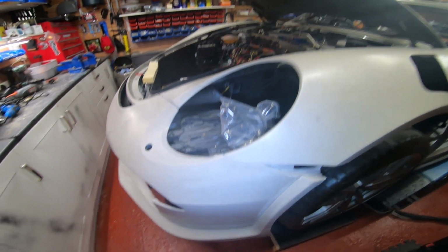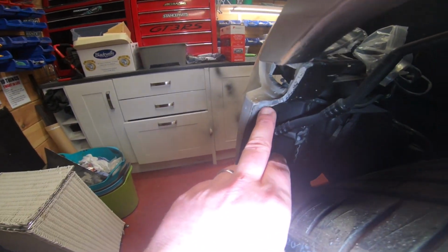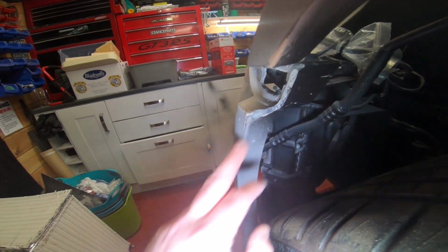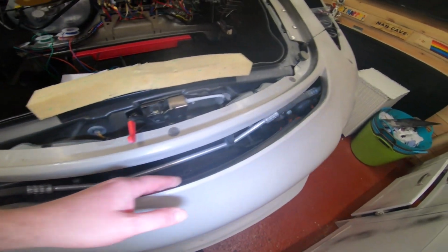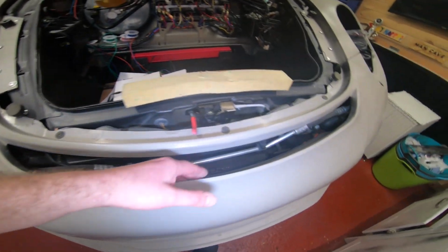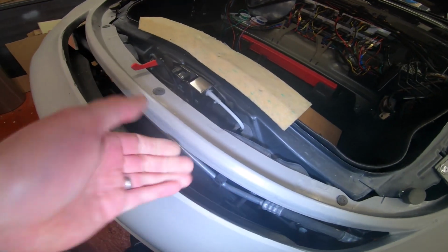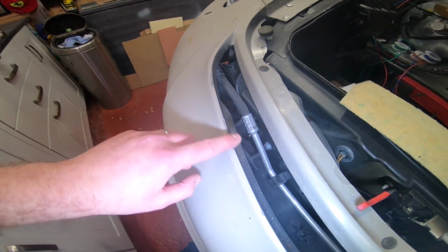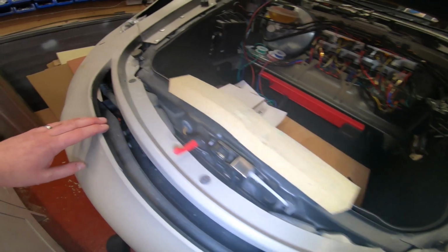But you need to be careful and actually neaten it all up, and be prepared for sort of faults in the mould. Look here, this hasn't come out very well for me, and I've got this sort of air bubble here and it's gone, so that's going to need to be filled in by the body shop, right? But all the bits you can get to, again, you need to cut this out. This will be filled with the grill. It's not like you're fitting a pre-made grill. You just want to make it so it looks good. This will have a grill underside, and the grill will be glued underneath these bits here where my fingers are, and you'll put it through and let it set. But you just need to make things as best you can. You can see here, I don't know what I did there so long ago, but that's a bit knackered. That's going to need to be filled in by the body shop.